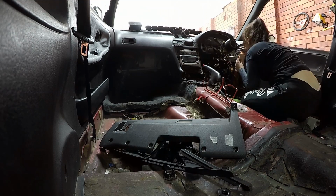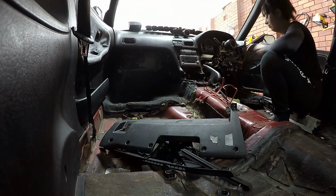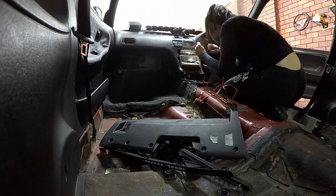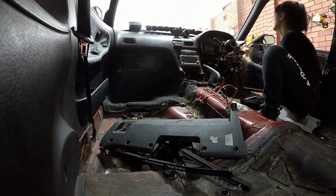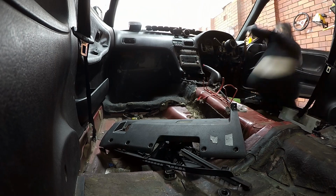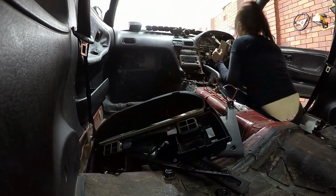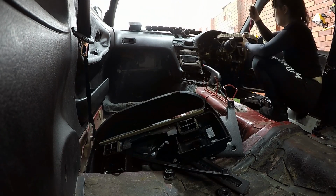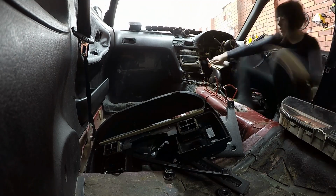So in those little button holes, there's actually some screws that I highly recommend you get a long screwdriver, but also a small-ish one to remove it. And also make sure it's magnetic, because losing those screws in there is actually a really easy thing to do, to be completely honest with you. So without removing those screws, you can't really remove the shroud along with the cluster. You have to remove that. Then there's one bolt and a couple of plugs for the cluster, and that is removed just like that. Boom! How easy was that?